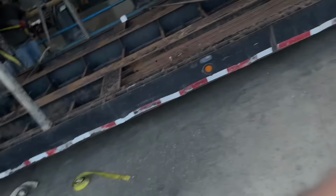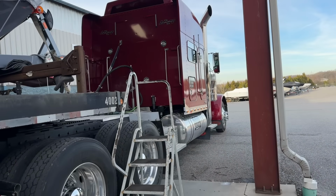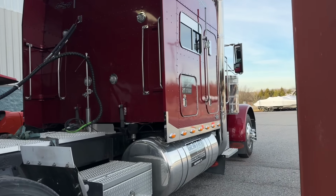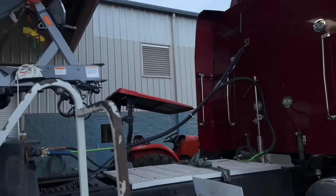If we get all that figured out today, then I'm going to go pick the trailer up. We're going to take Rooster and go get it. That's why I brought Rooster down here. I just fixed the starter again, the solenoid, and I also retuned it finally, and it is running way better. It's a lot smoother. It's still smoky. I'm still trying to get the smoke out of it, but I don't know if we're going to be able to. With that big turbo, I think the only way we're going to clear the smoke up is put compounds on it or downsize the injectors.